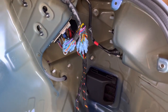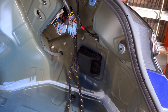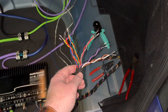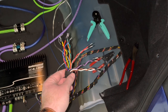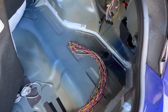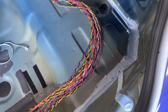I used 18-gauge wire to run the signal and speaker wires. I'm installing an AudioControl amplifier which will accept up to 14-gauge wire. The wire kit I purchased provided all the colors I needed. I color coordinated the new wires to the factory wires and needed about 5 feet for each of the speakers and signal positive and negative wires. I used wire ferrules for the speaker wire ends and bare wire for the signal wire ends. The amplifier's signal wire terminals were too small for the ferrules. I twisted the wires using a power drill.